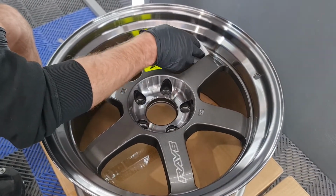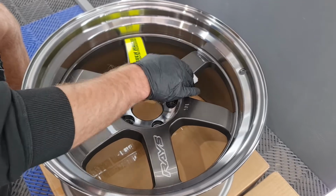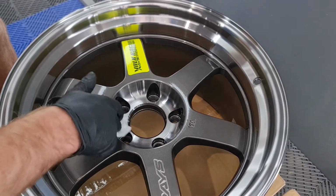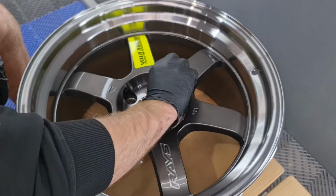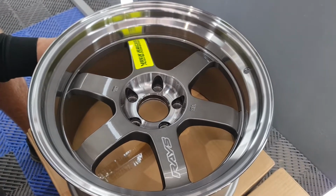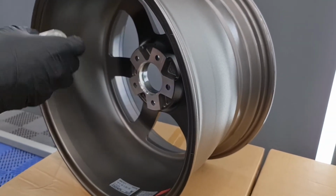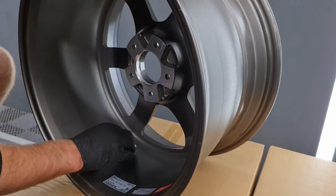Now OSREN Coatz O2 metal coating is a coating that solidifies over the metal surfaces and the painted surfaces. It's perfect for all your alloy trims and alloy wheels due to the strong anti-corrosive performance that it offers. This is usually why you need a specific coating for wheels: for heat resistance against the high temperature from your brakes, brake dust, tar, road grime, and then the corrosion that you can get on those chrome parts, which a standard ceramic coating just simply doesn't have the chemical resistance for. So while we wait for the wheel face to flash off, he'll have enough time to complete the inner barrel and the inside of the spokes.